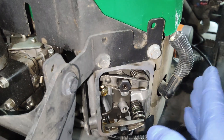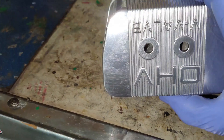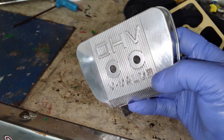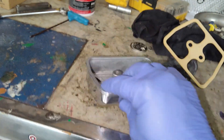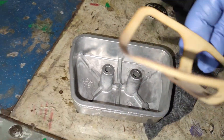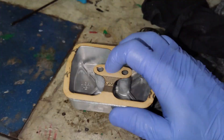At this point I had the spark plugs back in and we're ready to put the valve covers back on. I thought about painting the valve covers but I ended up polishing them — these are the original covers, and it took about half an hour of polishing with a buffing wheel on the grinder. Make sure your mating surfaces are clean, put the valve cover gasket on, run the bolts through to hold it in place, and bolt it onto the motor.